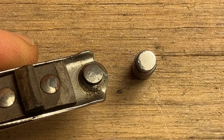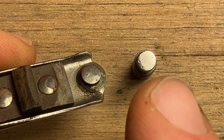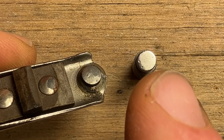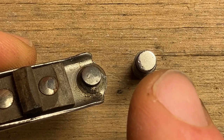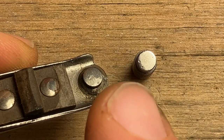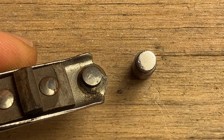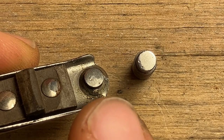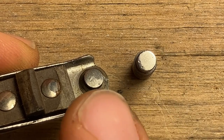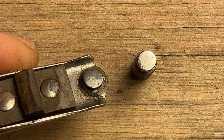What happens is there's material being vaporized off of the point block contact by the arc, and it's being deposited on the other side. That's why you get the pit and the bump. The material is always transferred to the anode. You've got these as the electrodes.